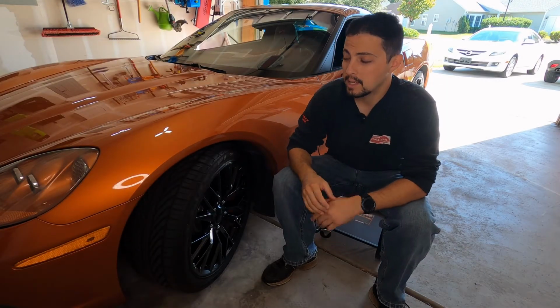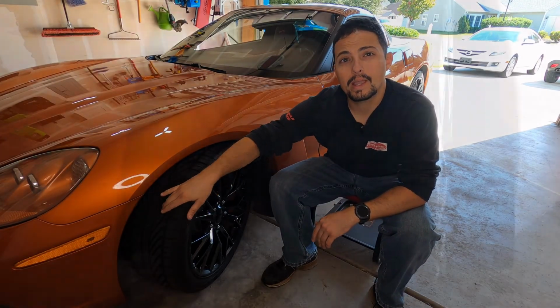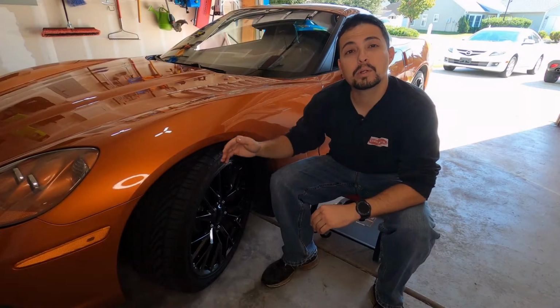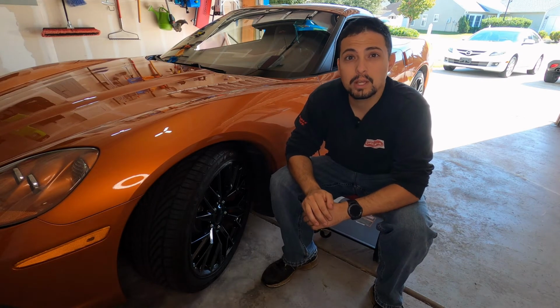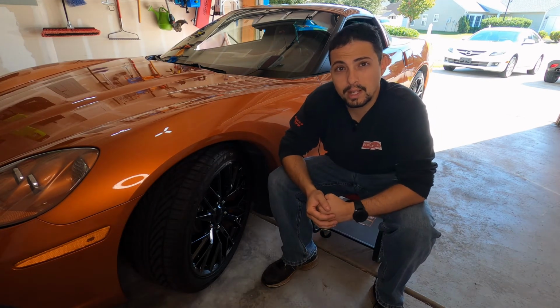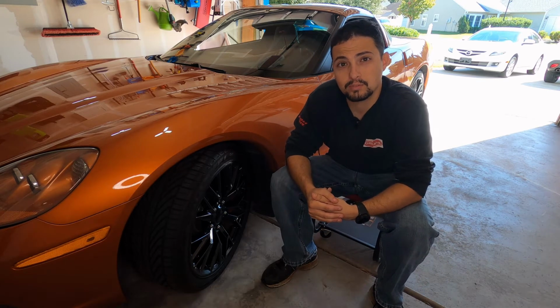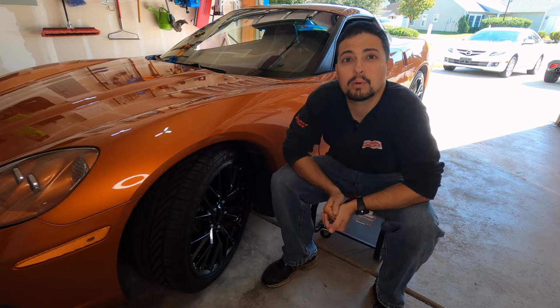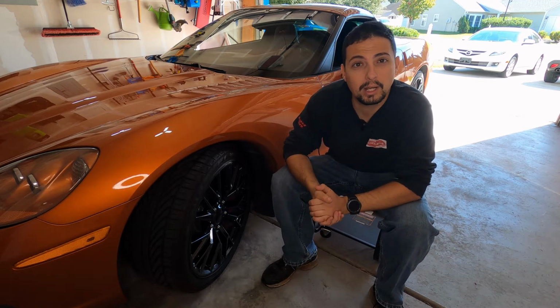in that direction. And as you can see here, the way that these treads work is on an angle in order to properly evacuate road debris and water through the treads most efficiently. If you were to put these tires on backwards, you would have an issue evacuating all that debris and water, and therefore your performance will suffer significantly. So that rotation arrow is very important when you have those tires put onto a car.